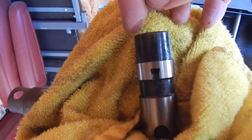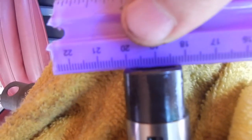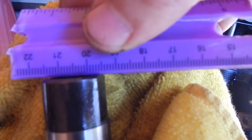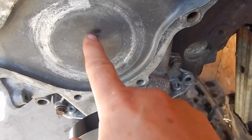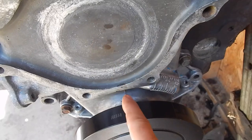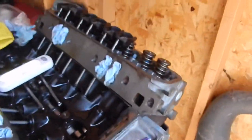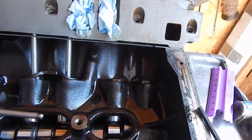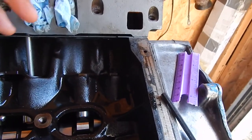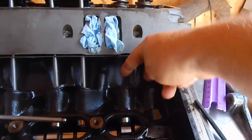Just to be clear one more time: you're touching the outside of each lifter, so when you lay the flat edge across, it should be touching both sides. If you get a slight air gap of a few thousandths, you know the cam is a little bit off. But again, I just match up 6 o'clock and 12 o'clock — the timing chain is straight up, the line is straight on zero, so we're good. The only thing left to check is whether the lifters are kosher. So if you slop in a camshaft, you can degree it this way — or really, verify the degree of the camshaft. Simple as this, with the head on. Oregon Cam Grinds, you guys get an A+ — it's dead on.